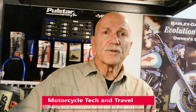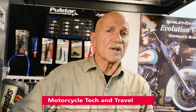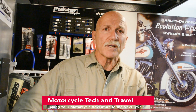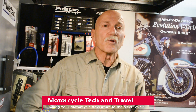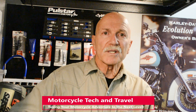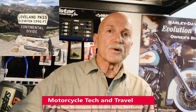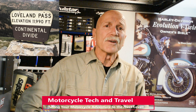As a footnote, higher altitude means thinner air that affects not only air-fuel ratios but also engine compression and combustion efficiency. When riding naturally aspirated motorcycles up a grade, there is a loss of approximately 3% of the engine's horsepower for each 1,000 feet of elevation. On a 10,000-foot pass in Colorado, a Sportster engine — whether carbureted and jetted properly or with EFI — will produce approximately 70% of its normal sea-level power. The only way to restore this lost power is with supercharging or turbocharging, which pressurizes and compresses thin atmospheric air into a denser mixture.